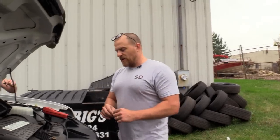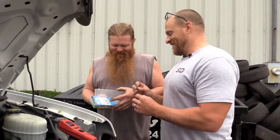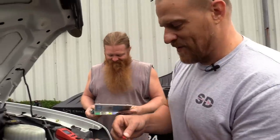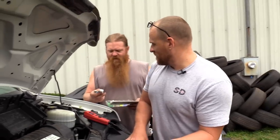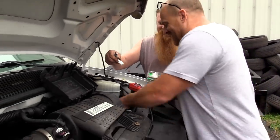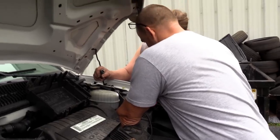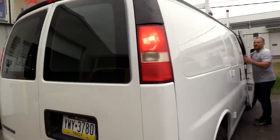We were just talking to the camera - it's kind of odd. If this fixes the problem, let's see if our right rear turn signal works. The fuse is replaced. Turn the right signal on. It's working. Good thing we followed this up because we were 99% sure it needed a BCM. But this is why we don't change parts. This is actually exactly why my brother wanted me to verify this for him as he's doing 50,000 other things.